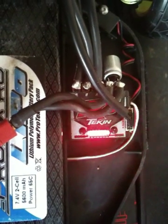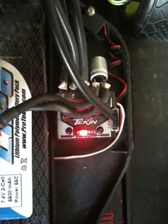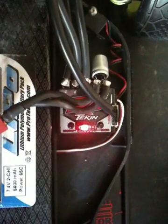To verify that you're getting full signal, I'll show you brakes so I don't blow the tires off my bench. Hit full brake and you can watch the LEDs ramp and they're going to flash. This indicates you're getting full signal, whether it be full brake or full throttle. Always look for this. If you're having an issue where your turbo's inconsistent, for example, always make sure you're getting full throttle. Some radios wander a little bit — if that's the case, there's a trick to bump your EPAs up a little bit after you've calibrated, bump them up 5% or 10%. But to make sure you're getting full signal, hit full throttle or brake, and all LEDs must light and flash.